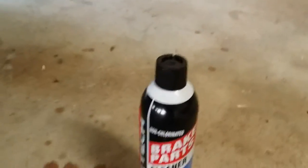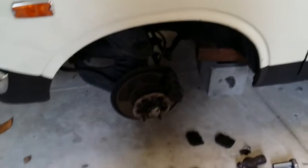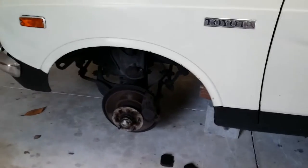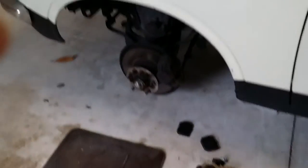I put some brake clean on there and sprayed it up real good, so that should take care of it. Before I left I had scuffed these rotors up really good. They got a little bit of wear on them and they need to be replaced. I kind of resurfaced them manually with some scuff pads just to get some texture on them, but that's been a while ago and they kind of got smoothed off again. This is the side that's been squeaking. It's only been one brake pad stopping the front — the other side was barely working unless you really jammed it. The inside piston was the only one really pushing; the outside's been kind of sticking and the fluid hits the other one first. So that's just because they're older brakes.